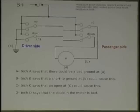The grounds go here, and it's connected through the normally closed contacts on both the down and the up switch. Goes over to the other side, and through the normally closed contacts on both of them. So both of these wires right now are actually what? Grounded, on both sides, correct. And the switches are in the neutral position. They're not up, they're not down. Well, this is...